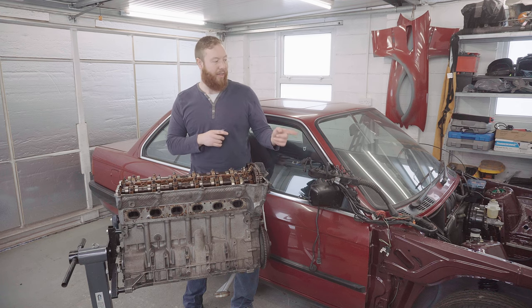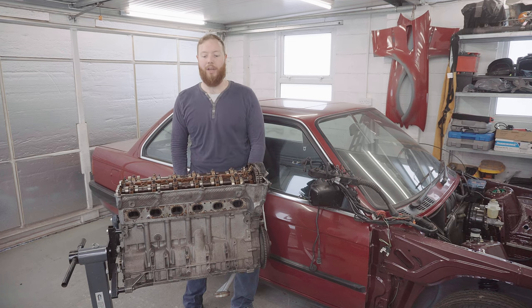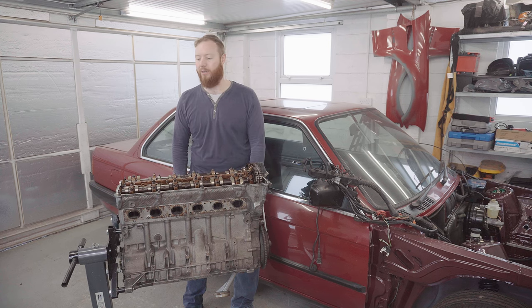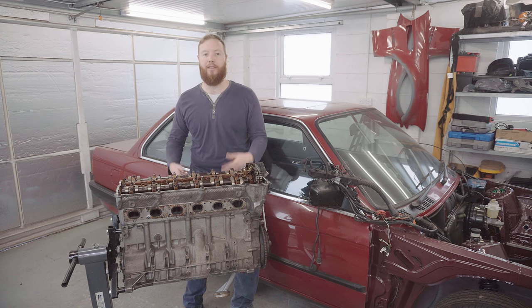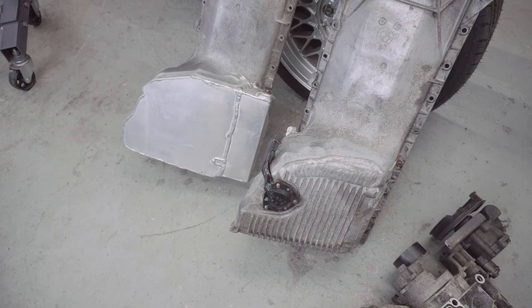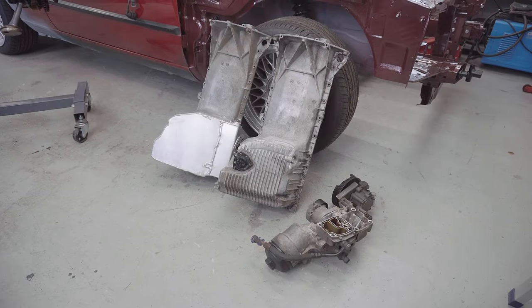But I think I have made my decision on which sump I'm going to use, and I'm planning to use my modified E34 sump that's a bit shallower to avoid speed humps in the future. I think it seems to be a fairly safe route to take from reading online. I think it might save me a lot of frustration later, because after all, once this engine's in the bay, to change the sump pan is an engine out job, so I'm hoping to start as I mean to go on.